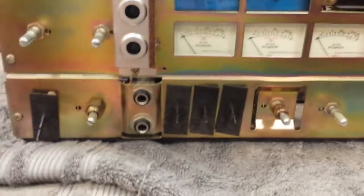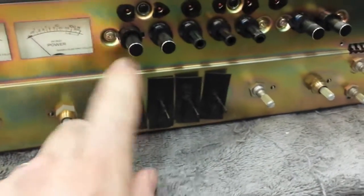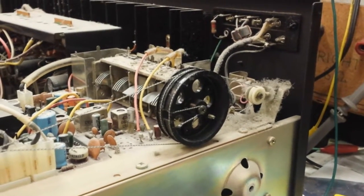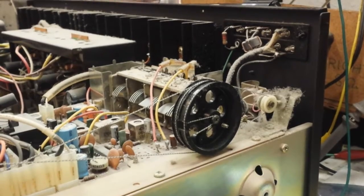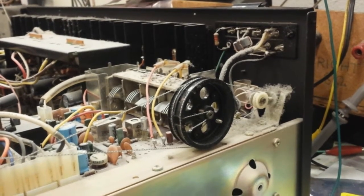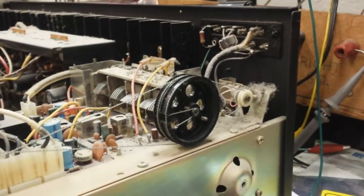Once you've done that, you're going to want to take off the nuts for all of the potentiometers. Behind here there are screws for all the switches. You're basically disconnecting the front panel from the rest of the world because we're going to remove it. Before we go any further, I want to give a disclaimer: you will be destringing the tuner. You'll be loosening that screw in the middle of the flywheel and unstringing the tuner so that you can get the faceplate up and away. If you are uncomfortable with this step, do not proceed. You may also wish to have a service manual which will tell you how to restring it. If you're uncomfortable with that, stop now and take it to a pro.